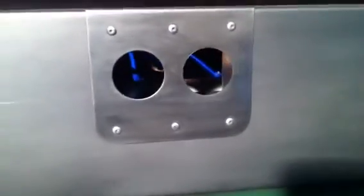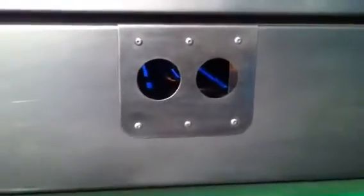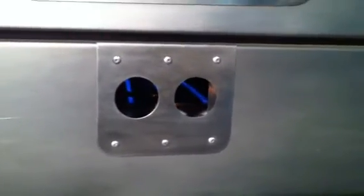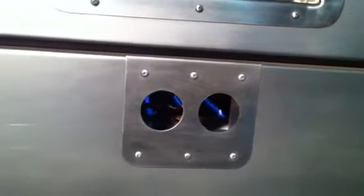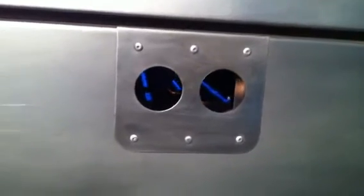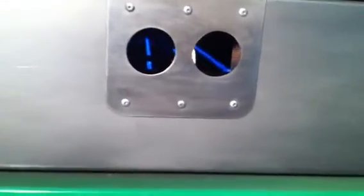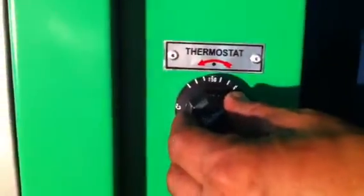Move it just a little to the left until you achieve the setting where the flame in the fire chamber gets slightly bigger, assuming it was too small. Mr. Renee will demonstrate this adjustment to increase the flame. You can see the flame is now adjusted — that is how we increase the temperature of the oven. Then put back the thermostat knob.